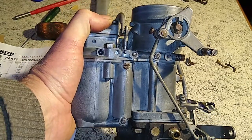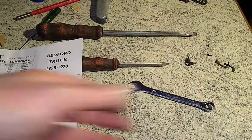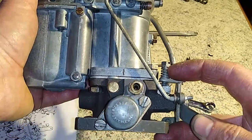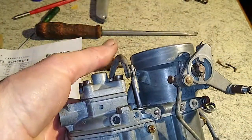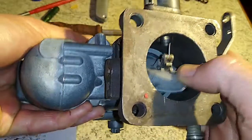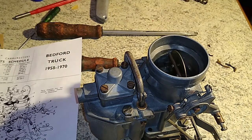That completes the build of the Zenith 48 VIR carburetor — thanks for watching. I'll go put this in now and see how it goes. Quick recap: fuel, idle mixture, idle speed — we've got a vacuum advance off the side, accelerator pump plunger so when you put your foot down it plunges, your choke plate on the top, and a throttle plate in the bottom with built-in governor. Done — there you go, thanks for watching. Keep on trucking on, see ya!